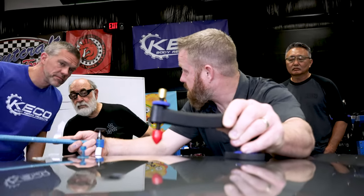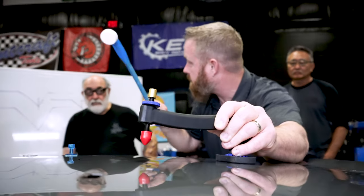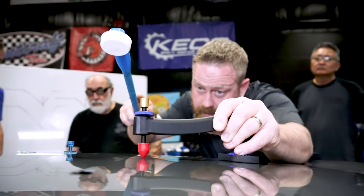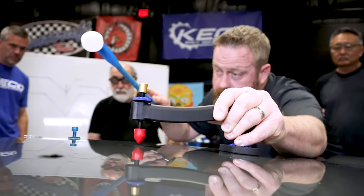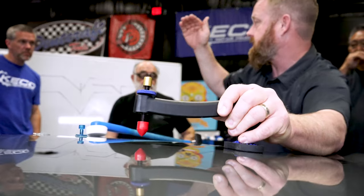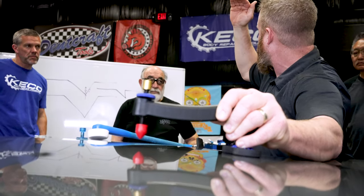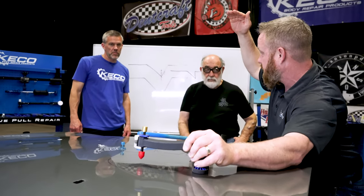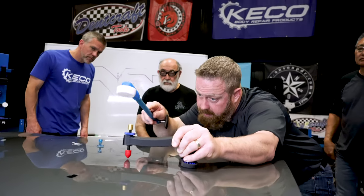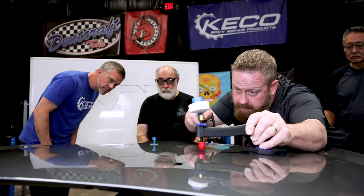We didn't really change it much. I want to increase my aggression, so I just want to hit just a little bit harder. Come in and tap. Got a little movement there. Now, just like strongest to weakest, deepest to shallowest, highest to lowest. We always want to knock down our highest peak, and then our next highest peak, and then our next highest peak. As we move through here, right, that changes, and we're constantly adapting to what we've got. I'm going to come in and tap this down. Come in and tap a little bit more.